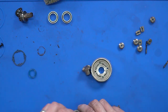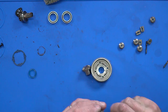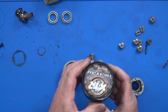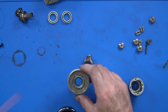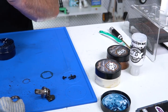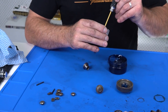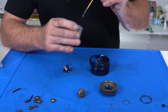I'm going to start by putting the silicone O-rings into the case, making sure they're all sitting nice, then into the big ring gear. I'm actually going to use a rubber grease — I've got an XTR product here — and this is going to protect because these are a silicone seal and we're using a silicone based oil. They will over time affect each other and try and become one — the silicone will actually penetrate the O-ring. So this grease will act as a sealant to save the diff oil affecting the O-ring seal. Don't have to absolutely lather it — just a light coating. Beautiful.